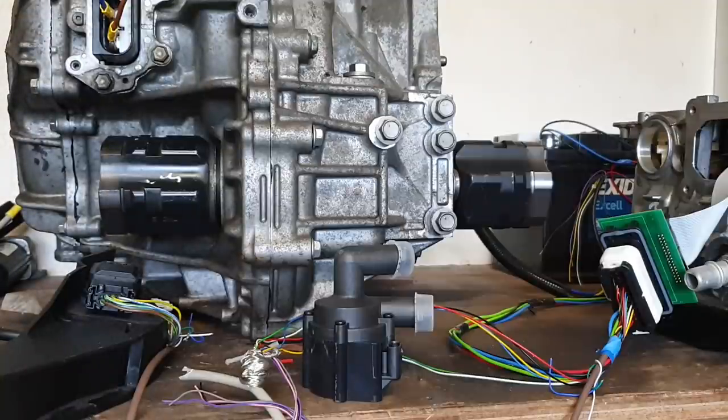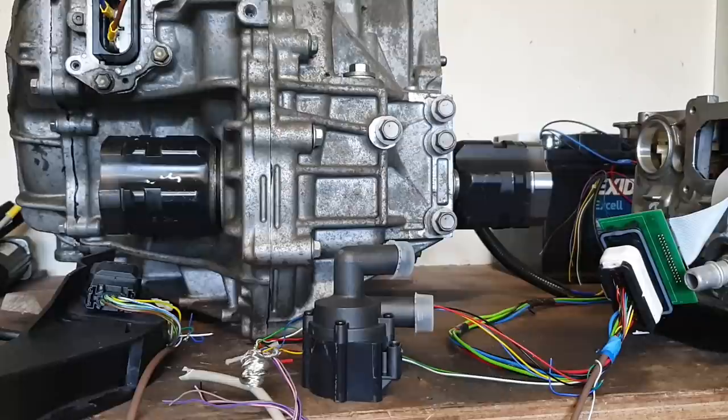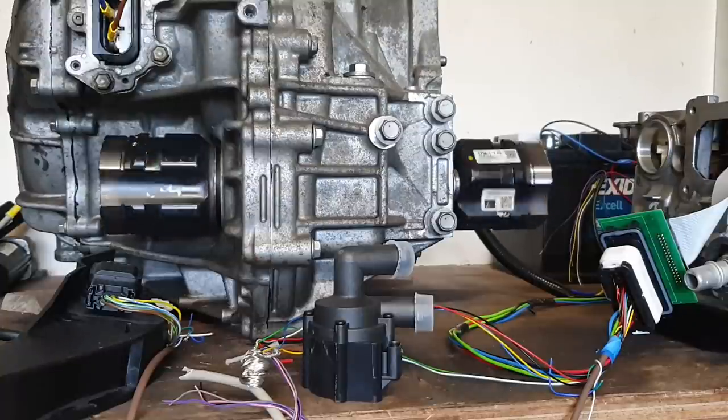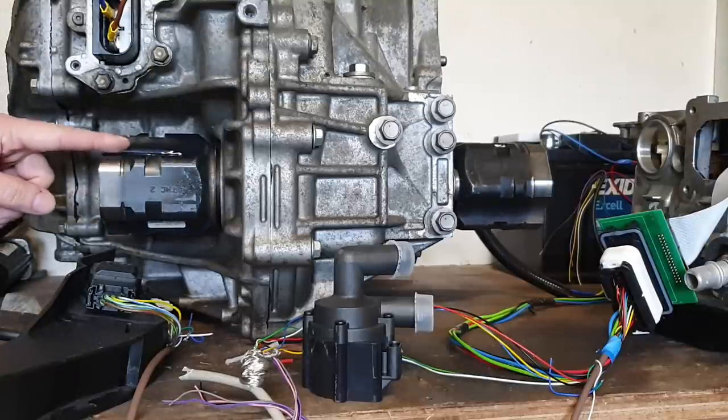So now, this is the point where we actually want to do the small moves. So we're at 9,900. So let's go to 10,000. So I'm still moving in jumps of 100. So I'm not quite down to individual values yet. So back to spot values again, back to our manual ID. And again, we start with our 3 amps because we don't know what could happen here. 3 amps, nothing. 6 amps, nothing. 12. Very interesting. And we begin to turn. But note something. It's in the same direction.